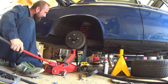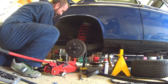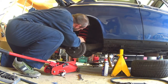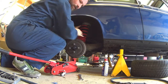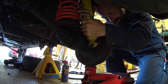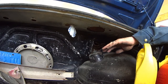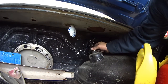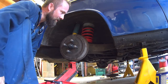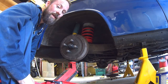Both are loose now — with any luck this will just jump right into place. That one's up — that's good. Two up — that's good. It seems to be generally where we want it, so I'll get the strut back in place. It took some doing, a lot of wrestling and fidgeting, but I got the spring to seat in its spot. I'm going to put the car on the ground, roll it out of the garage, and see if these spacers put it in the right spot — because I don't want to be doing this again.